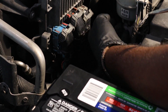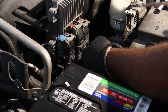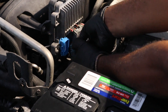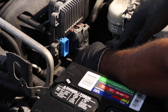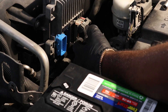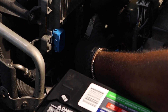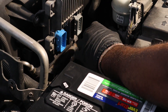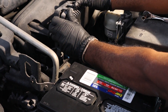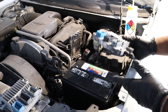Be sure that all bolts or latches are completely loosened before attempting to remove the harness. The harness may be snug and could require slight force. We recommend pulling the harness from the base, not the wires. If you wiggle the harness slightly while pulling, the harness should slide right off the plug. If you have more than one plug, repeat the process for each one. Once the harness is removed, you can now remove the old PCM.